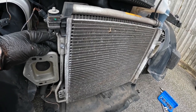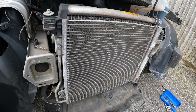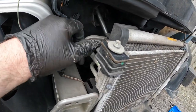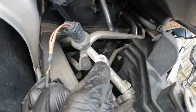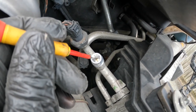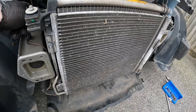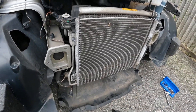The idea is it's reclaimed using a machine — I used to operate such a machine quite a lot, always replacing aircon components and reclaiming and recharging systems with the correct amount of gas. I don't have that equipment with me. I know for a fact there's nothing in this at all — these little valves are where you hook up the equipment, they're a bit like bicycle valves. Don't do this at home because if the system is charged, a frozen liquid will come out and it can cause freeze burns. This system is discharged, so I can safely remove this component.